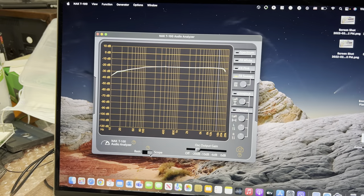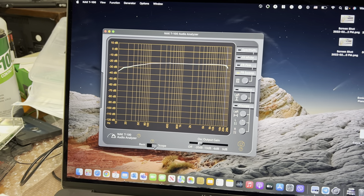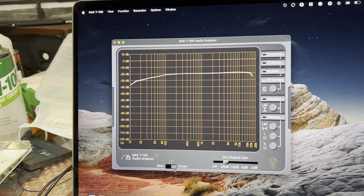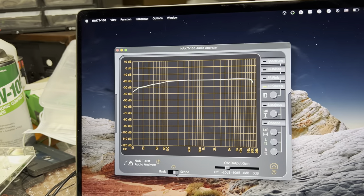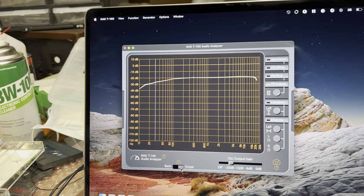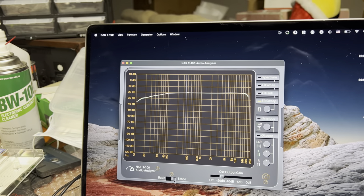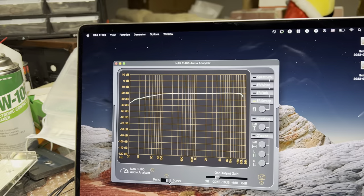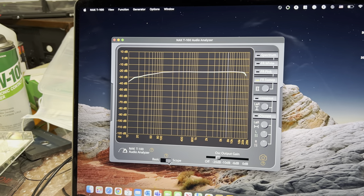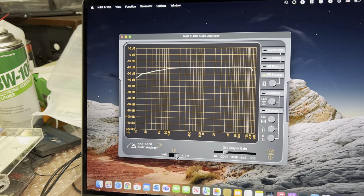Watching the type 2 sweep: 16, 18, 20, 22 kHz - perfect, no complaints. This was almost the last generation of the Nakamichi decks, and I only complained about that one region. If they would have done it better, it would be a deal recorder. You can see it looks very, very nice - we can get more than 20 kHz on any tape type, and it's almost flat.